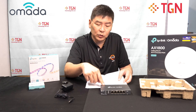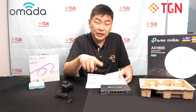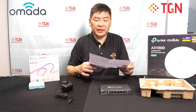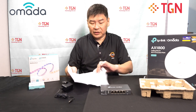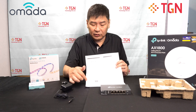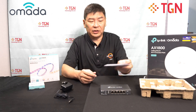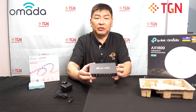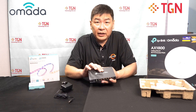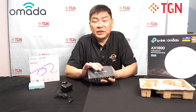So you need to make sure you set a static IP within the range of 192.168.0.x, slash 24 — don't forget that. The rest will be as per normal, however you want to set your routings and do all the rest of the settings. I will definitely be playing around with this router to look at the console and see how it's configured, especially with the management on the ONT. I'll let it run and make another video on my experience using this particular router.